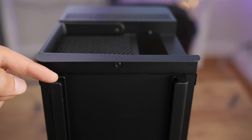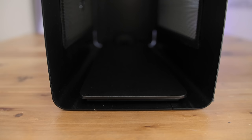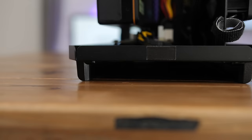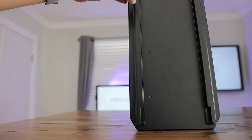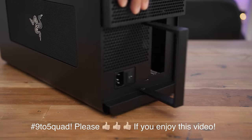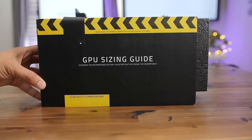The thing that makes the quick-release lever really work is this little rail system. The rail system attaches to a little plastic piece inside the outer chassis, and this plastic piece prevents metal from rubbing against metal — so there's no screeching when you insert or remove the inner chassis. There's way less friction. It allows you to easily insert or remove your GPU with just a single hand. And that non-slip pad on the bottom of the unit really helps out with the whole mechanism, keeping it firm on the desk, allowing you to slide out the inner portion just like that.